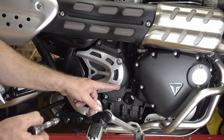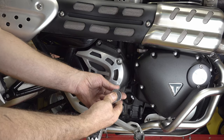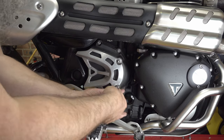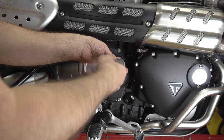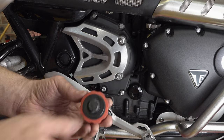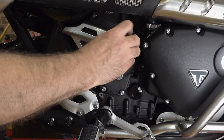So now let's get on with removing the old ones. What I'm going to do first is remove the front sprocket cover and loosen off the front sprocket before I start taking off the chain, back wheel and everything. The front sprocket cover is held on with a couple of 8 millimeter bolts. I'll loosen those off - if you've had this off before, you'll know there's the rear brake master cylinder under there as well.